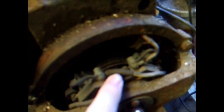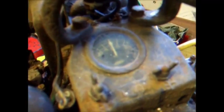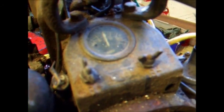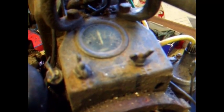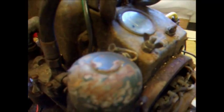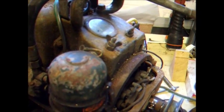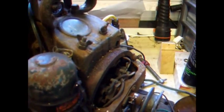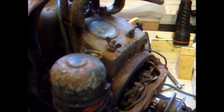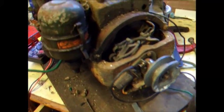Everything just suggests there's not a great deal of wear, though it might have done a fair bit of run time — it's certainly been well looked after. I think it goes up to about 12 volt, maybe 24 volt, but it does charge up to 30 amps, which is pretty beefy. When you think about your ordinary car charger at about eight amps, putting 30 amps into a battery it's not going to take long to charge. I'm looking forward to getting this going and charging a couple of flat batteries — certainly a lot better than having a car charger on for 12 hours.